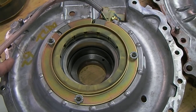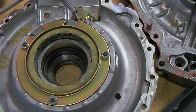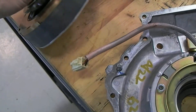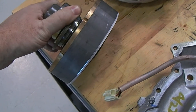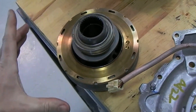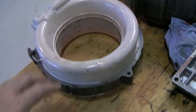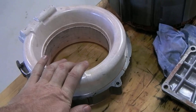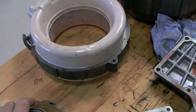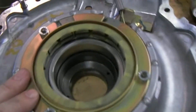In order for the AC synchronous motors in the Toyota hybrid setup to function properly, the computer needs to know what the position of the rotor is. This rotor here — which is the rotor for MG1 — is a big permanent magnet, so there is a substantial magnetic field that comes from this rotor and it needs to interact with the windings in the stator for MG1. In order for the computer to know which windings must be charged with which phase of current from the inverter, the computer needs to know where the rotor is inside the stator. That's what the resolver does.